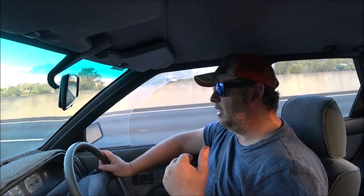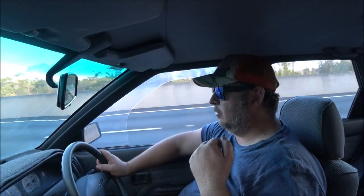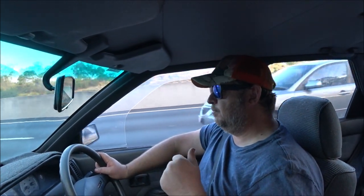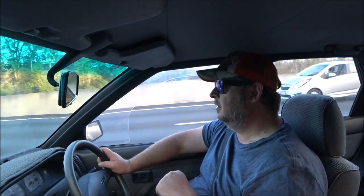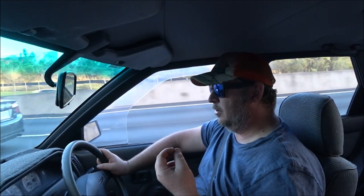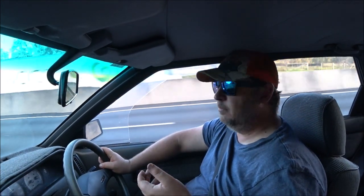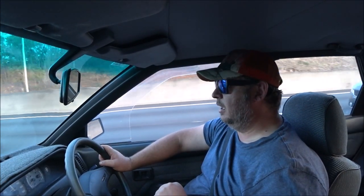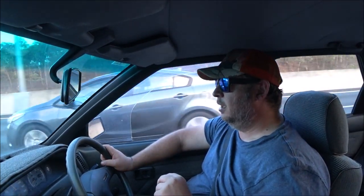I'm just going to let the brake temp come back down and then we'll do some bigger stops on a private road just not far from here, and that'll get them well and truly bedded in by the time I'm driven home. Once they cool down again, that should be it, and then just a bit of a bleed and we'll be good to go. This is my exit.